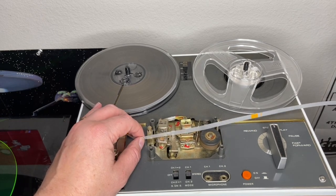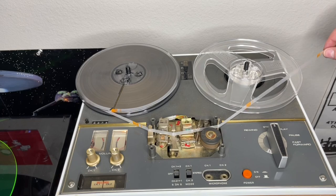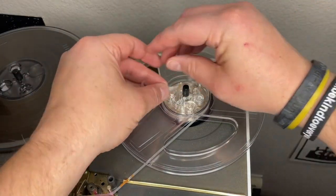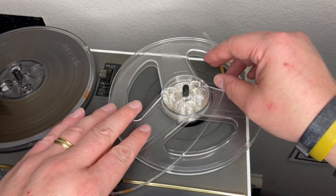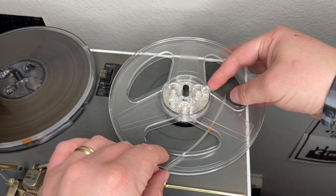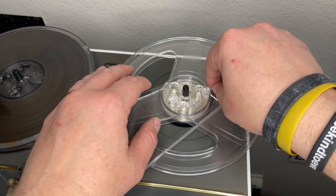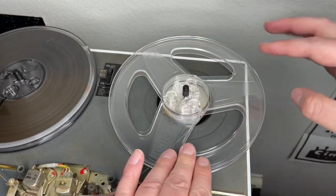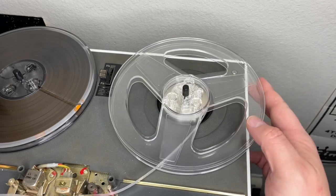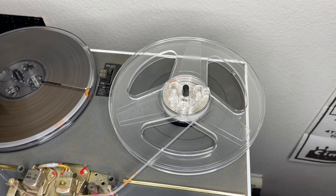So we've got our leader here. If you're using an old tape, you oftentimes don't have the luxury of a non-playable leader — you have to just use the tape itself. If you're working with a deck that's vertical, there'll often be rubber pieces that go on here to hold the reels in place. There's also a little cutout right here, and what you can do is take the edge of the tape and stick it inside there, just the tip — this is what I would consider the proper manner to do this. Hold it in place for a couple of rotations until it holds, and now it's ready to go.